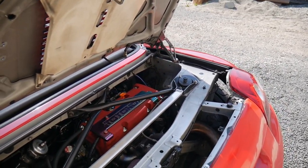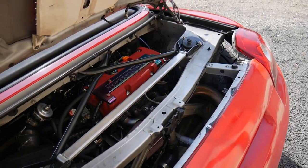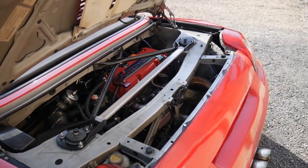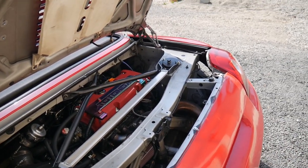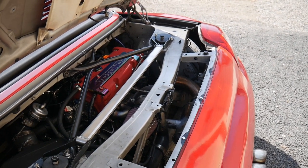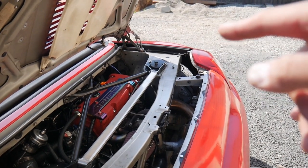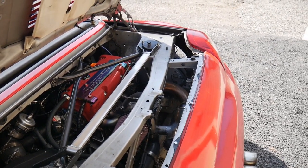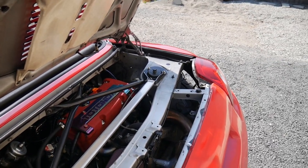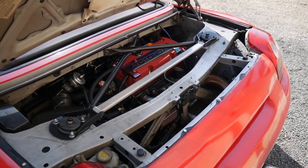Then one night at like 2 or 3 a.m., I found an old archived post on a K20 Turbo Civic from 2018 with a similar problem. He had replaced his wideband but then had to calibrate it with the K-Pro V4 and set the parameters for that sensor in the analog inputs on the Hondata software — you can change which sensor you're using. I changed it to the AEM 30-4110 instead of the 30-2004, the parameters matched much better. I plugged it in, calibrated it in free air, calibrated it in the exhaust, and after that it started up and just ran.